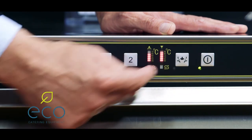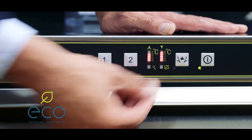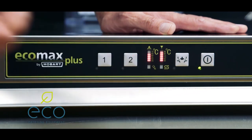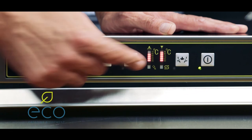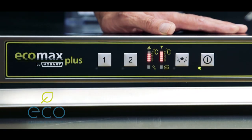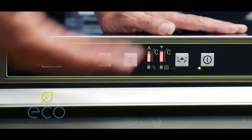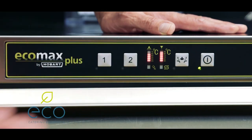There are two lights underneath: one is the salt light and one is the regen light. If the salt light comes on with the little salt shaker icon, it means you need to fill the salt up. If the regen light is on, it means the softener is regenerating — you'll get a slightly lengthened cycle while the softener regenerates to keep soft water for the machine.